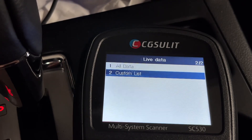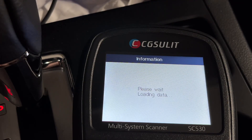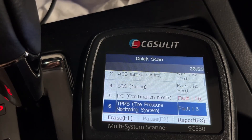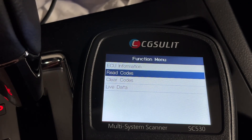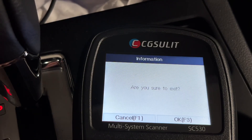I'll turn the engine off. Now let's go to Subaru. It says Smart VIN or Manual Selection — I'll choose Smart VIN. I'll choose North America. It found the VIN — I'll hit Yes. It says Quick Scan or Control Modules — I'll hit Quick Scan. The scan is complete, so we can go down through this and it will show some faults. There's one that says tire pressure low — there was a point where the tire pressure was low, so that got logged. It's an old error code, not a current one. You can also clear codes or look at live data.